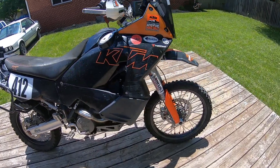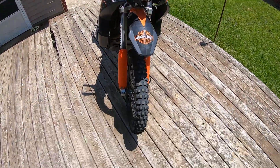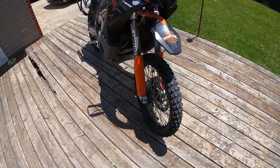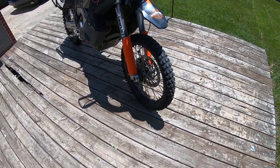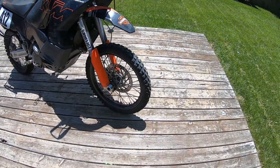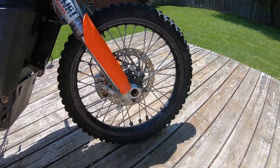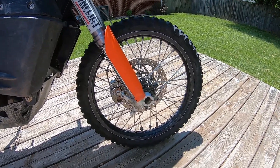Starting at the front of the bike — it looks a little different than what you'd normally see on an adventure bike. Starting with the front wheel: Woody's Wheel Works, 21-inch, 21 by 1.85 XL rim. It's not an A60 — if I do it again I'd probably go to an A60. I've got a pretty good bend in it right here, but this thing's held up great. I never had any spokes come loose or come out of true, even with all the hits it's taken.